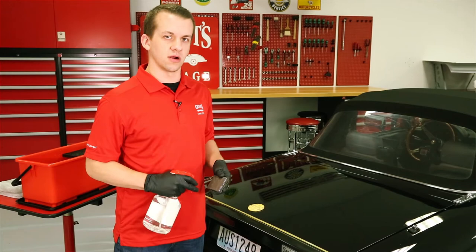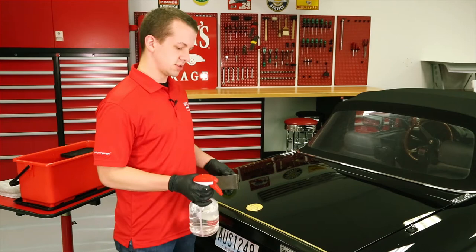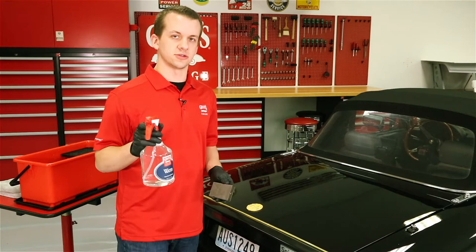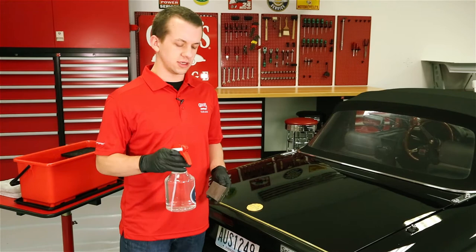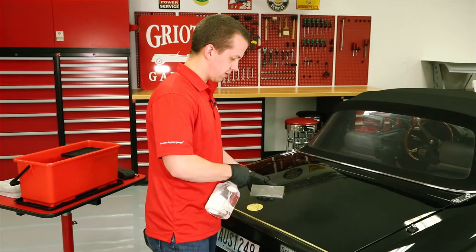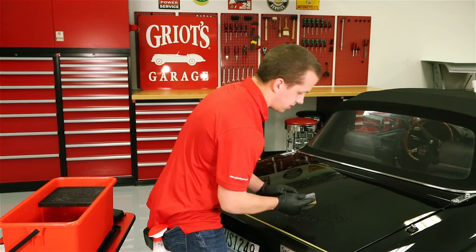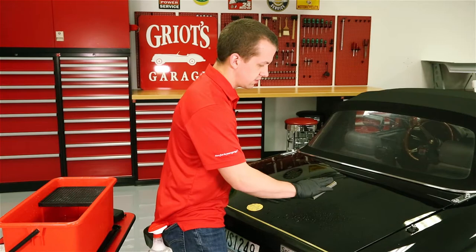You can also keep your sandpaper stored in water for weeks at a time — just make sure you're switching the water out so it's not getting moldy. Our paper can stay in water for extended periods without any issues. I've got a spray bottle with water that has a drop or two of our super concentrated car wash, which is strictly a soap with no silicones or additives. This gives us a little better lubricity on the surface without impacting the sanding process. We're going to spray the surface and also spray the paper. It's very important that throughout the process you're flushing your paper while you're sanding.